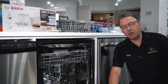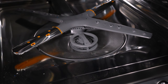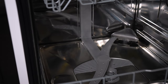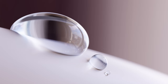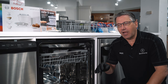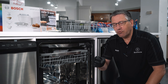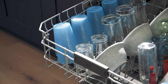One important thing many people overlook: it is really imperative with newer dishwashers that you use rinse agent. Many newer dishwashers — like this one — have no heating element at the bottom for drying. Some use fans, but this is an evaporative drying system. Rinse agent is a surfactant — it takes a water bead and flattens it out, making it very thin. Just like a smeared water drop evaporates much faster than a standing drop, the rinse agent speeds up evaporation so glasses come out dry.